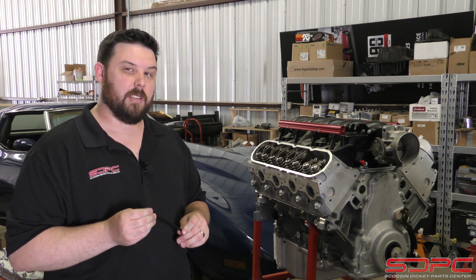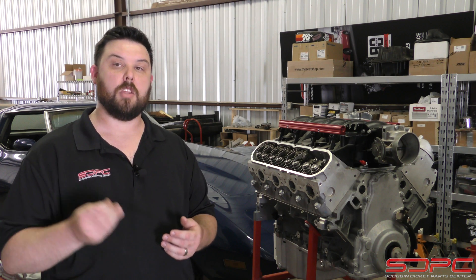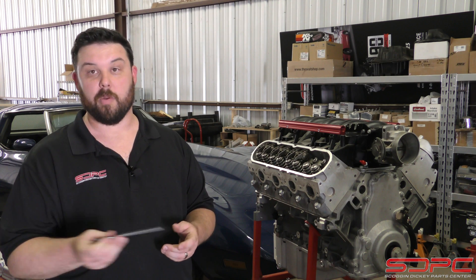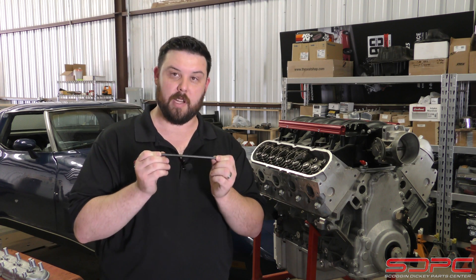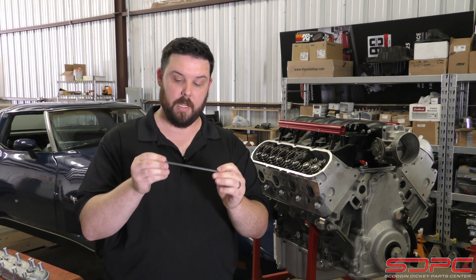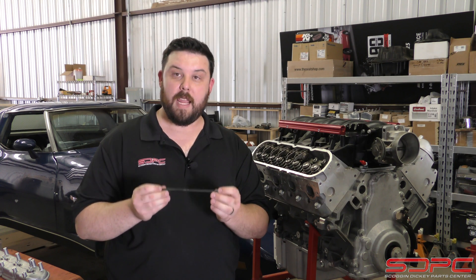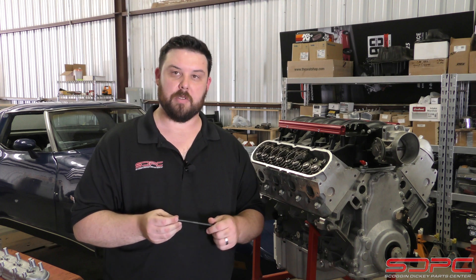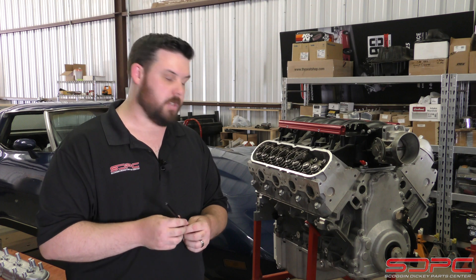So you can see why it's a little bit difficult for us to determine the exact pushrod length that you need over the phone — we're not there to help you measure, even though we wish we could. So today, we're going to show you. I have a CompCams pushrod length checking tool here. It looks like a pushrod, but it's actually threaded and it measures between 6.8 to 7.8, which is the range we need. We know we're going to be pretty close to 7400, we just need to figure out where.